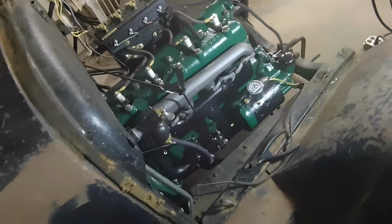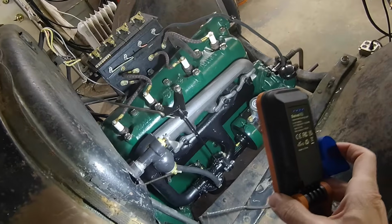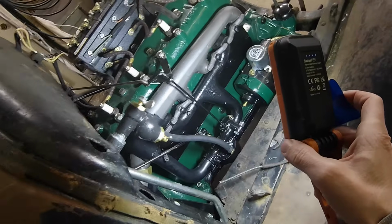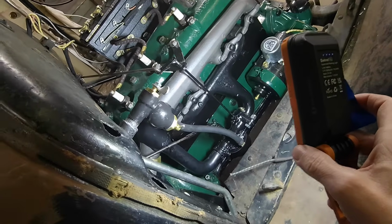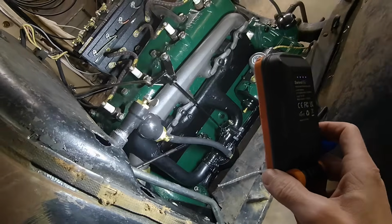I'm going to get some tape, and I'm going to mark this at the point where it turns freely, and then we're going to regroup. Where's my light? You guys deserve to be able to see. Okay. Back it out to here. Back it out a little more. See how that looks. I don't want to go too far because then the choke will fall off. Right there. No, it's still binding. Right there.